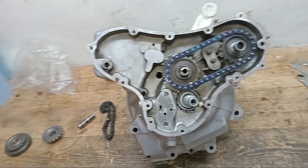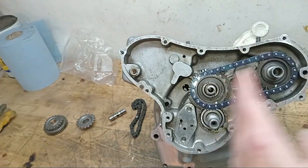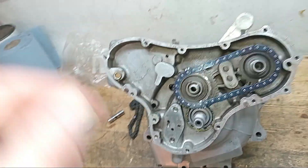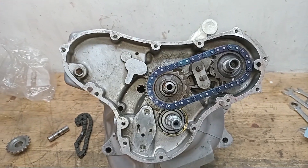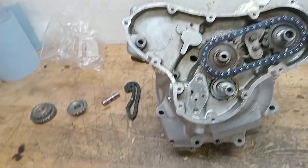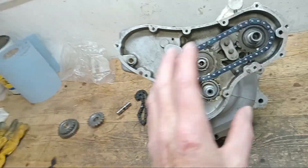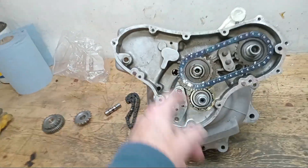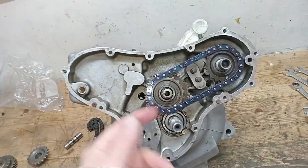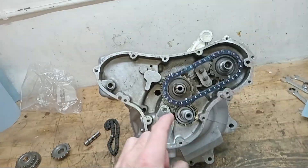Why there is still a variation on such a short chain I don't know, but I've put a new camshaft in and it's made no difference. If the bushes are worn on the camshaft, that might pull the camshaft over, but it wouldn't be eccentric. I've been scratching my head with it, and that's why I haven't posted - I've spent time taking everything apart, ordering parts, waiting, and then another part hasn't worked, and so on. I think I've now sorted it to within tolerance. Next video I'll show the rebuilding of the timing case. The rest of this video we'll go through all the work I did one at a time, the reasoning behind it, and all the measurements I took.